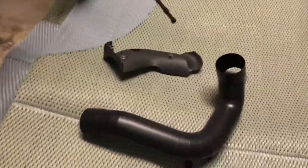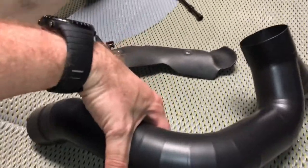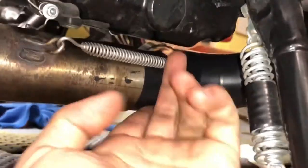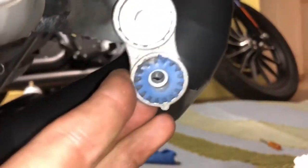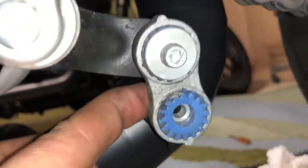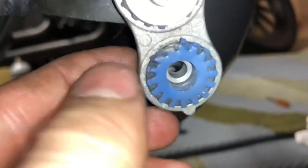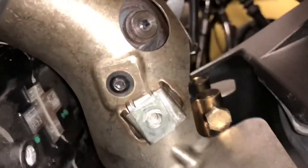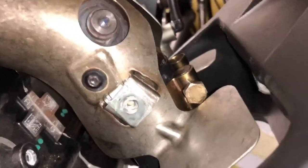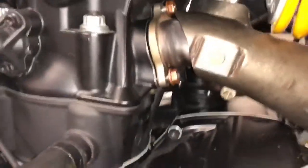Now we're going to take that down pipe piece and plug the Competition Works one in. It's kind of hard to see but we got it connected down here at the bottom — the old pipe pulled in and then the spring attached. You just reuse the regular spring. The Competition Works has that little hinge there. Went ahead and put that down pipe in — this thing swivels but it should be in the downward position so you can get it on. I'm gonna have to pound it up a little bit with the mallet until it settles into its spot.